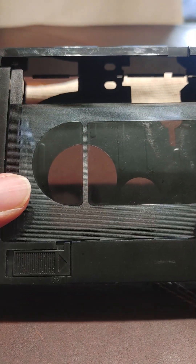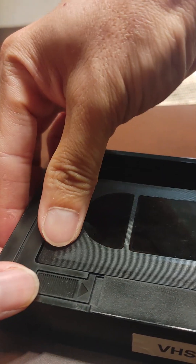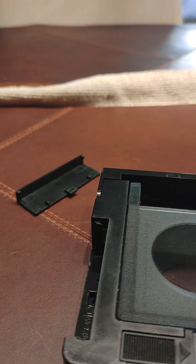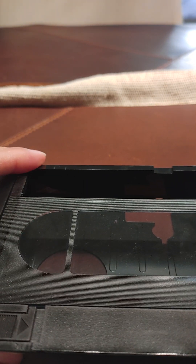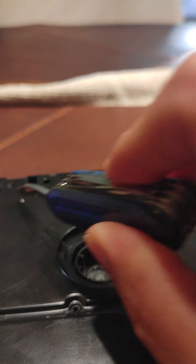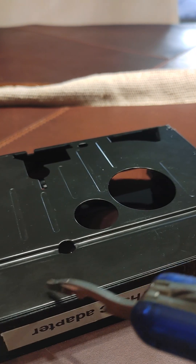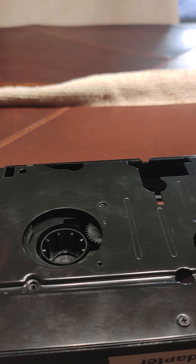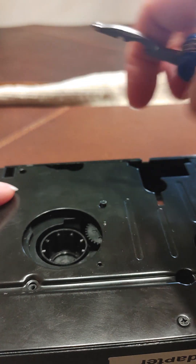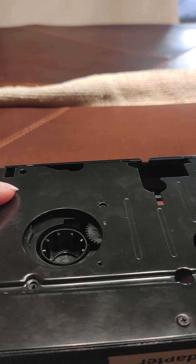What I'm going to do first is remove the battery to prevent any further damage — this disables the mechanism. There are about eight screws on the back which you need to unscrew: the top, here, here, here, as well as the corners. I've already removed six of them, just going to remove the last two. These screws are pretty low quality, so make sure you use a high-quality Phillips so that you don't strip them. If you strip them, you're not going to be able to retrieve this.